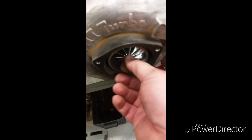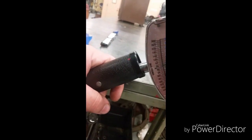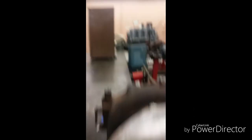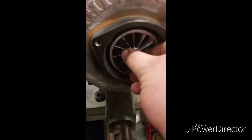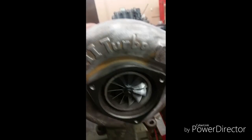Alright, now we can see the turbo here. The nut is loose — I had to jerry-rig some stuff in the back to hold it. We're going to put this on there and torque it. Just over 10 inch-pounds. Take that off and check it out — look at that, it spins normally. It's not spinning separately from the shaft. Spin it back.